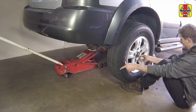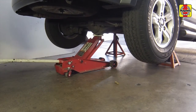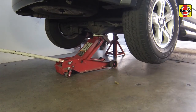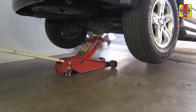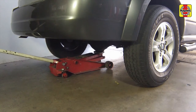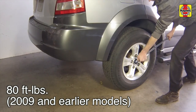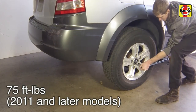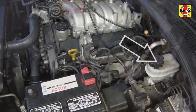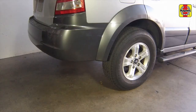Install the wheels and lug nuts, then safely lower the vehicle. Tighten the wheel lug nuts to 80 foot-pounds on 2009 and earlier models, and 75 foot-pounds on 2011 and later models. Refill the master cylinder reservoir to the indicated lines with the proper type of new brake fluid if necessary, to compensate for the fluid taken out previously. Check the operation of the brakes carefully before placing the vehicle into normal service.